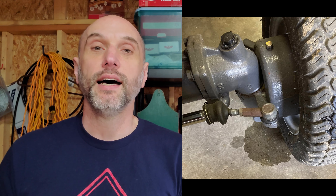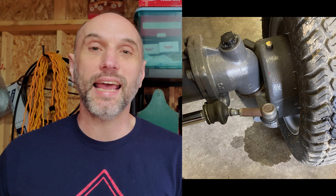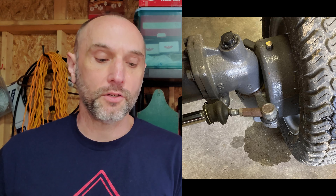I think it should be vented because especially when you get into the cold temperature season and then the front axle gets warm, you get pressure that builds up or a vacuum, and you end up getting fluid leaking. That's not a good thing. It normally leaks out of the axle seals at a certain point, so that's why you would want it to be vented.